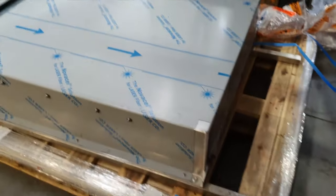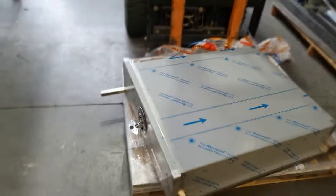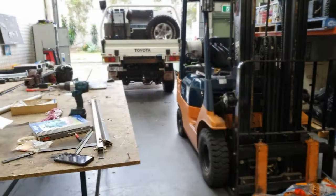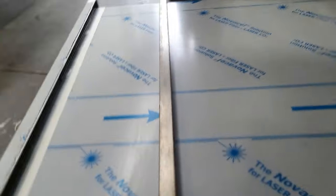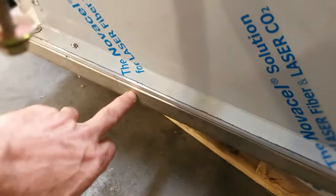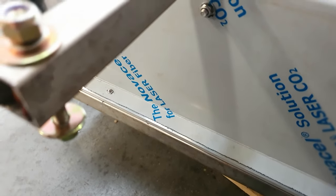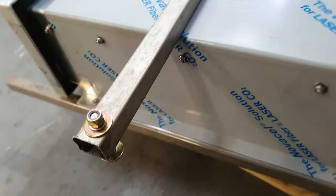I can polish that up and make it look nice, which is another bonus. All I've done is tech screwed it in each corner — just enough so that if I've made a mistake I'm not putting too many holes in it. Now I'm going to quickly test fit that in and get ready to put the cross bars in. These will stick to the other side of the drawer on those cross braces and I'll bolt them straight through, which means a little bit of pre-drilling and marking. That's why they're going straight into the truck now.